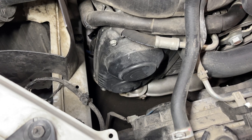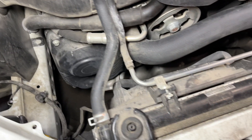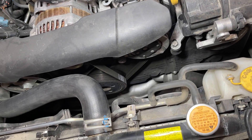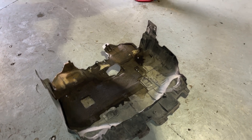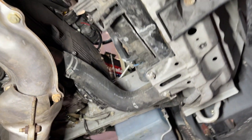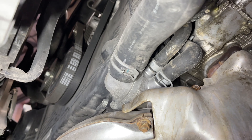As suspected, they are dual overhead cam — or dual side head cam. The game plan here is I'm going to drain the coolant, remove this radiator just to get some more room. The belts come off, the timing covers come off. You get a lot of room but it's just a little tricky to get the belt routed. Right under the car I got this plastic cover off, so here you can see the timing covers. I'm going to remove this drain cock right here and all the coolant drains. You can see the water pump is actually right there. The thermostat goes into it, so all that needs to be removed.